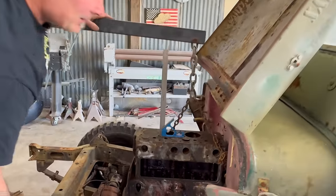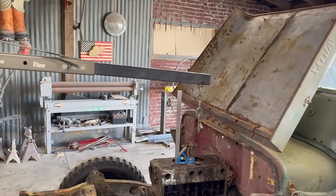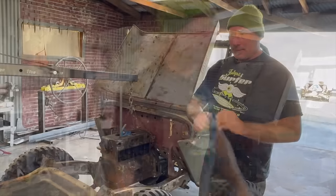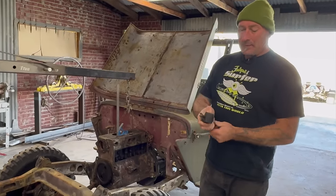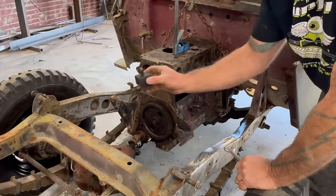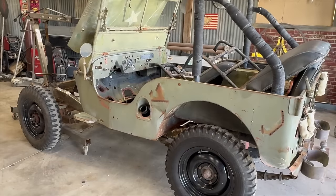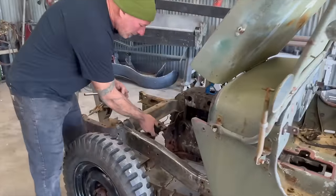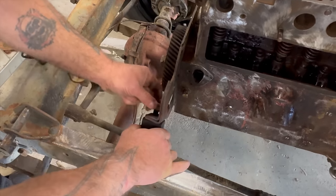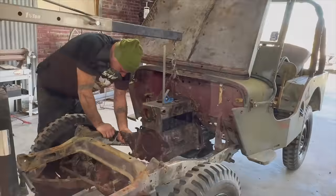It's not a perfect world, but see there's plenty of room behind the engine — that won't hit the firewall. So again, this thing's custom — we're going to build these mounts. As long as that crankshaft is centered in the frame rails, we're going to do whatever it takes. These came from Summit as well — simple little rubber deal, they go right there. We build something to attach to the chassis — one on each side. These are pretty big studs coming off of this, so I just found a couple of lug nuts that happen to match that thread pitch — I'm imagining it's like half-inch fine thread. I'm just going to put them on upside down to hold it temporary.